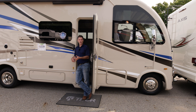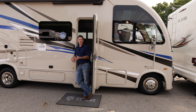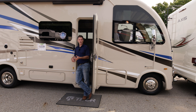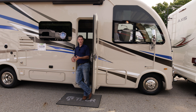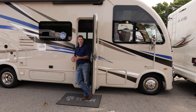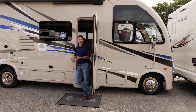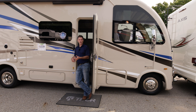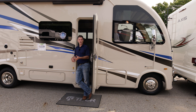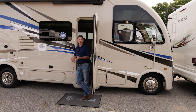There's a lot to talk about in here. This is the new Ford chassis — they updated the interior with a new dashboard and new radio system. Over here you have a place for your phone and your heated remote mirrors that work just like in your car. You have fog lights, headlights, and an auto headlights setting — turn it all the way to auto and they'll turn on when it's dark enough. There's also an auxiliary start feature: if your chassis battery is dead, press this in, turn the key, and it will use power from your house batteries to start your motorhome.